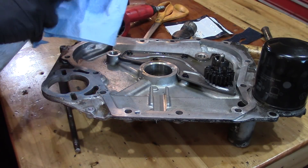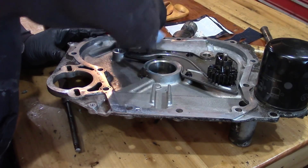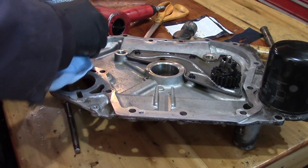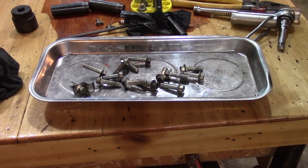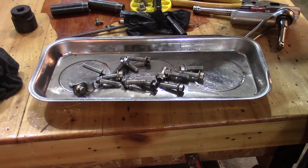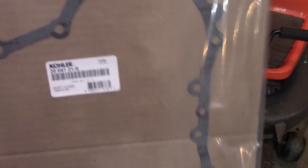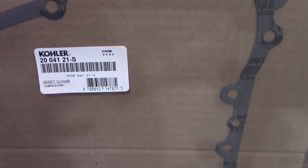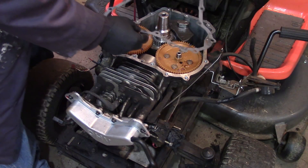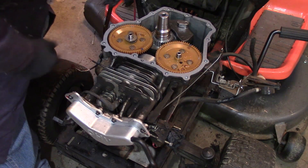I'm going to take a shop towel and clean off all around here, getting any debris. I already went through it once. These are all the bolts from the sump — the problem is they come loose — so I'm just going to clean them off and hit them with a little bit of compressed air. Here's the seal; I'll link the part number and all parts used in the description. There are locating pins on here, so make sure you find those pins and get this thing on right.